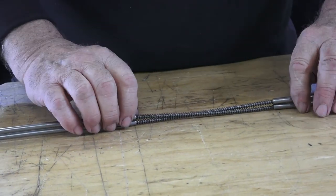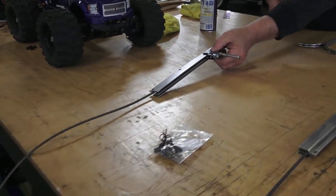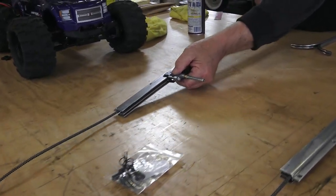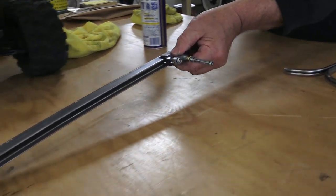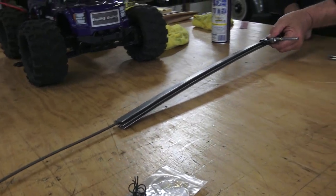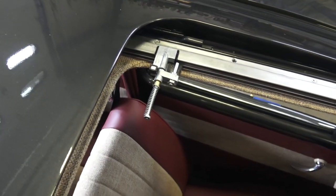Make sure your sliders and cable slide really well on these rails. You might want to use some WD-40 and make sure these work well, because you want this roof to slide sufficiently back and forth without binding, grinding, or skipping.